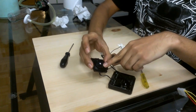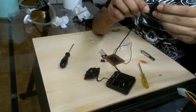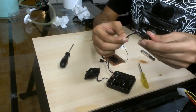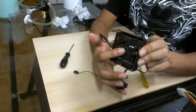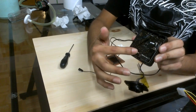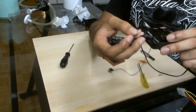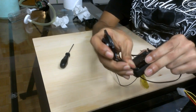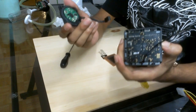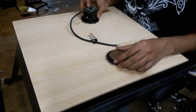What I suggest is, if you are using a resistor, do not put it on this cable — this is running the circuit board and it's recommended to run this controller at 12 volts. Do not do that; it will damage the board. What I recommend is to put the resistor on the pump cable, so it will only reduce the pump voltage, not the controller itself. That will be a lot safer and you won't damage your controller.